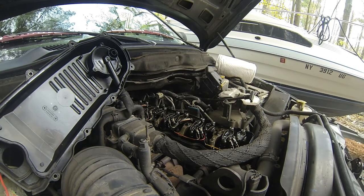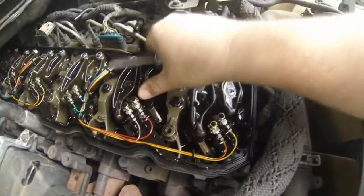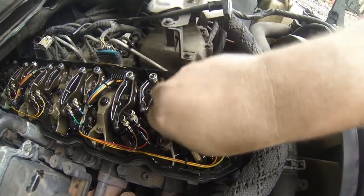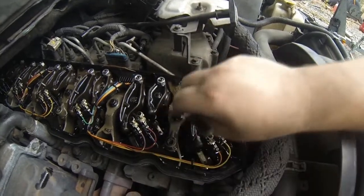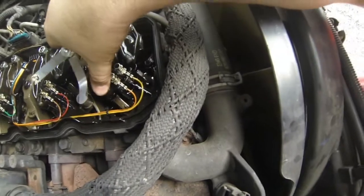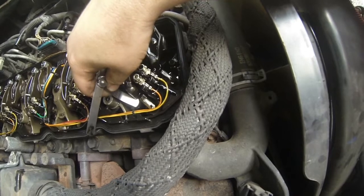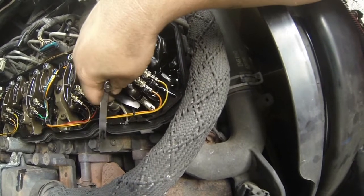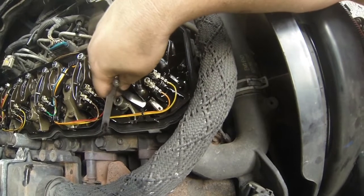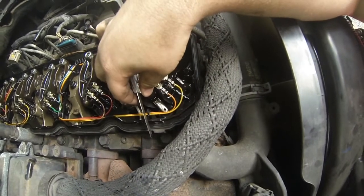The way you're going to test it is — if you look, there's a bridge in there. The small one is the intake. This one's got a little bit of motion to it. You should be able to squeeze that in there. This first one has no load on it — you'll be able to rock it quite freely. This one's actually so loose that I can nearly remove the bridge without any problem. That is not how it should be. These are definitely, definitely way overdue for an adjustment.